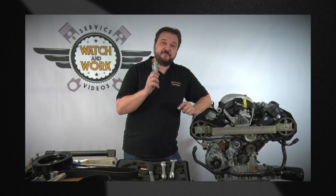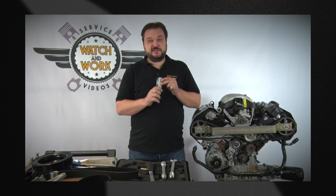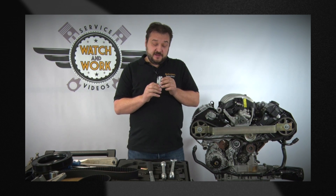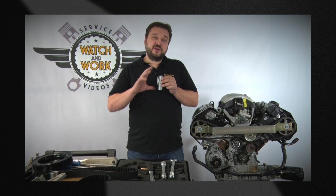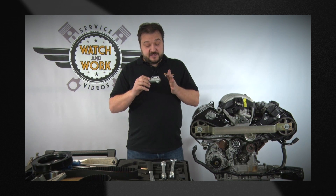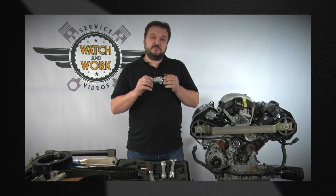Take care with the hydraulic damper. It doesn't have any particular change interval specified, though it ought to be changed every time as a matter of course. Many of you tend just to loosen the hydraulic damper's two bolts without compressing it as shown, and then compress it in a vice afterwards. The hydraulic damper must never be compressed in a horizontal position. This can result in air being entrained and cause damage.